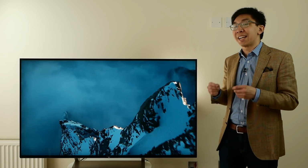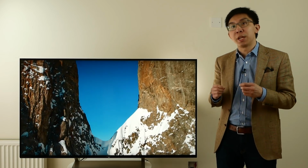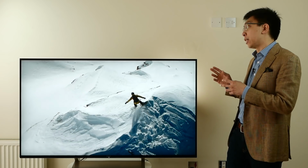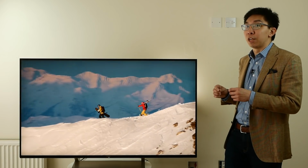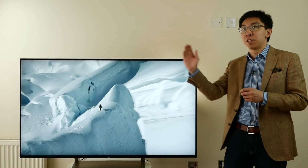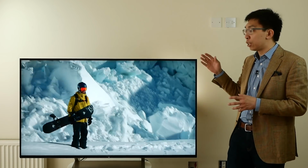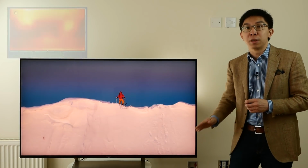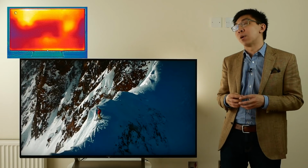Last year's Bravia XD93 was equipped with Slim Backlight Drive technology, but this year Sony has changed the LED module arrangement on the XE93 and called the technology Slim Backlight Drive Plus instead. On the 2016 XD93, 2 layers of LED modules were stacked together on the sides of the screen, but on the XE93, the LEDs have now been moved to the top and bottom of the display, as you can see from our thermal scan.